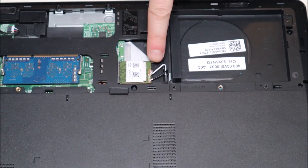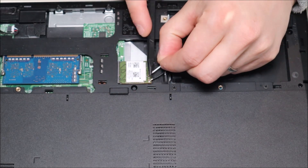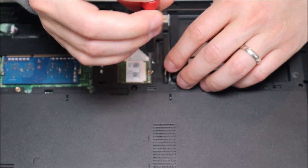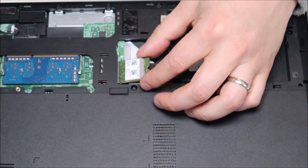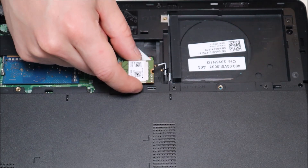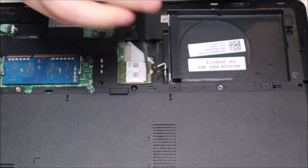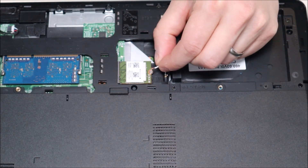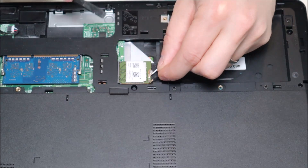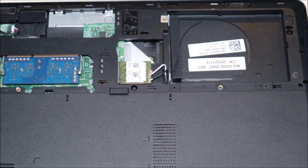Over here you have your Wi-Fi card. It's held in by one screw with two antenna wires in it, just like most laptops. To remove it, we're going to pop up each antenna wire with a plastic pry tool, then unscrew the one screw holding it down and the Wi-Fi card pops out. Oftentimes you have to take out the Wi-Fi card to continue into the computer, as it's screwed into the bottom case. To reattach your Wi-Fi card, slide the new one in, screw it back down, and then these antenna wires — they're just snaps. Make sure you have them in the correct port, put them down over where they go, and snap into place. You can hear it snap.